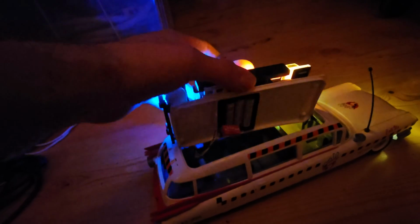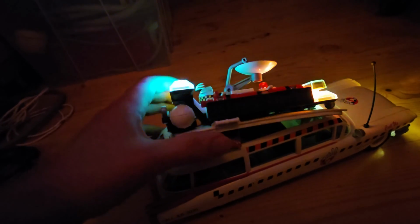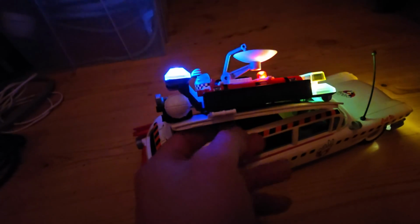And for anybody who's watched my videos at all, you know that I have discovered the secret of non-stop blink. So if you press the buttons on here, they don't do anything right now, because the 6th dip switch is the non-stop blink. So if I switch the first one off, so the first dip switch is power to the siren board, the built-in board here, because I actually removed the original negative wire on the batteries and routed it directly to this switch. And then there's a wire going from this dip switch back up to the board to give it power when I switch it on.